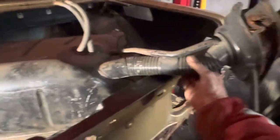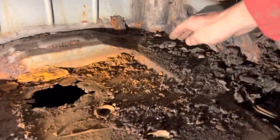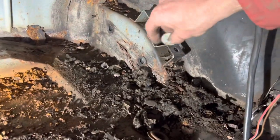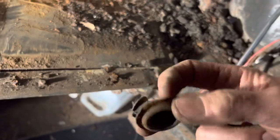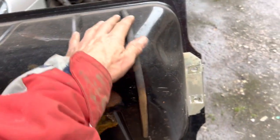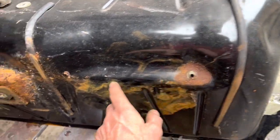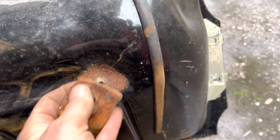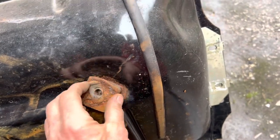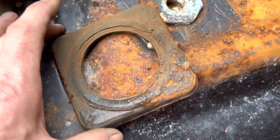I think we've just about got this fuel tank out — let's take it out and have a look at it. You can see what the car looks like without the fuel tank in there, and in fact there is one of the missing washers that we'll be needing to secure the fuel tank in the other car. This here is the special angled grommet that they use for the fuel tank breather. One of the reasons I wanted to take this tank out is I wanted to see what padding gaskets are on it. You can see there are three rubber strips — one, two, three — that are just stuck on to stop the tank banging on the bottom of the car. There's also this big square rubber gasket and a rubber piece of foam between the fuel return line and the car.